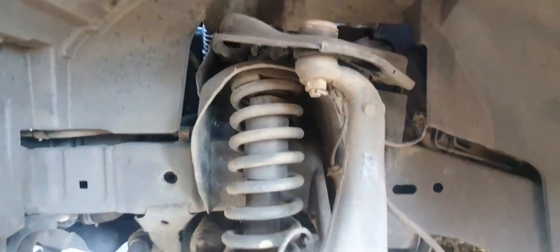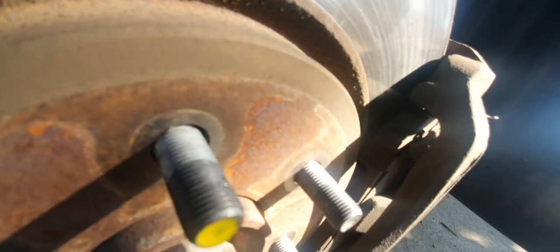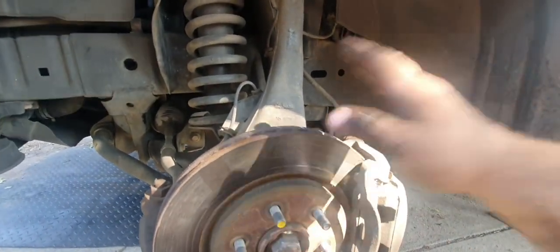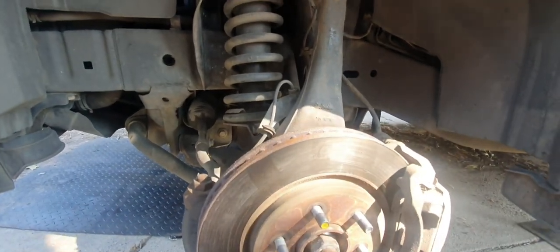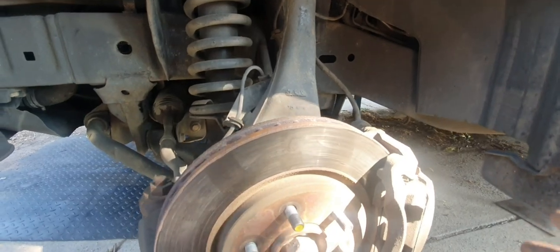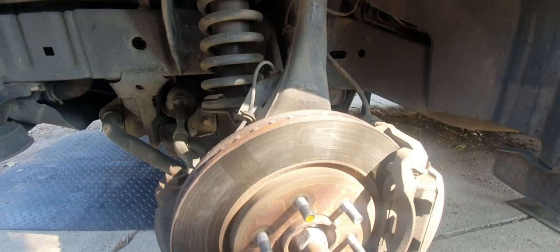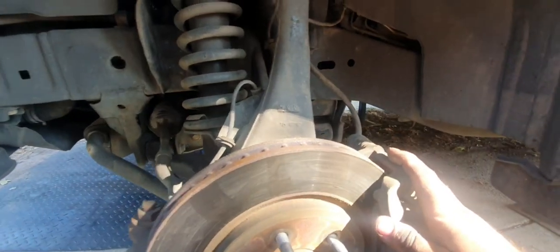And brake rotors, of course. I mean, they're glazed up to buggery. We've got plenty of pad left. I actually did a pad slap, which is pretty much just slapping a new set of pads in and not machining the rotors. At the time I didn't have time, and I don't think we had the money at that stage just to get the rotors machined, but anyway, it doesn't overly matter too much. They're a bit squealy, a bit squeaky, so that's going to be on the list of to-do things: machine rotors, new set of pads.